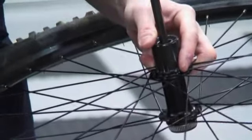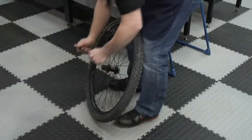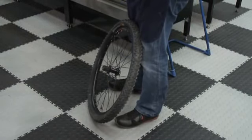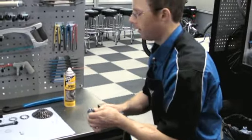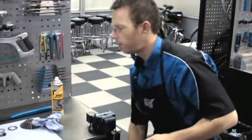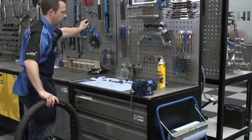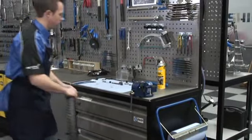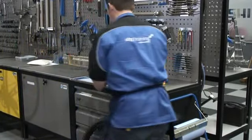Torque is probably about 25 to 30 Newton metres, so it's pretty tight. If you over-tighten it, it will just spin and then you've wrecked the hub shell and you'll have to buy a new hub. Now I'm going to replace the ball bearings — nine per side, quarter-inch size. Don't forget to also inspect the cone nuts for damage.